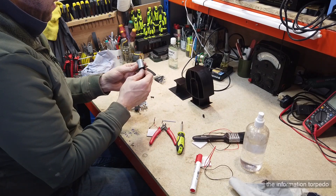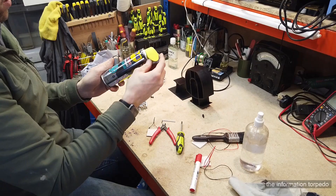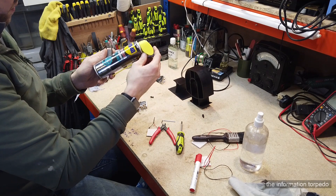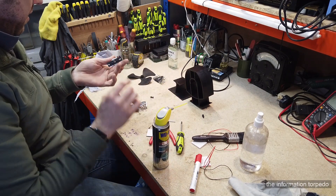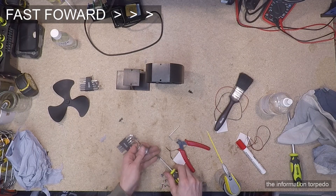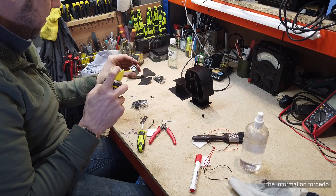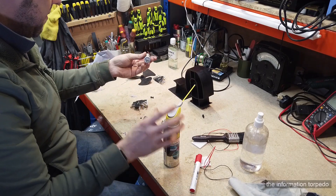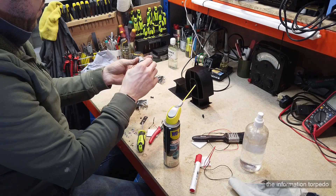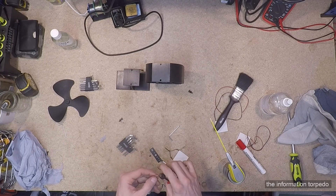Now for the motor — it's got a bit of a grind to it, metal on metal. I'm using lithium grease, which is a water- and heat-resistant lubricant, long-lasting, for use on metal-to-metal contact. On my particular fan I removed the end plate, which lets me get more lubricant into the motor. The motor was dry as a bone — after lubricating it, it's feeling loads better.